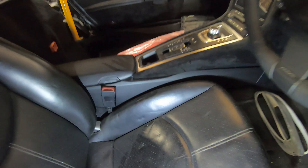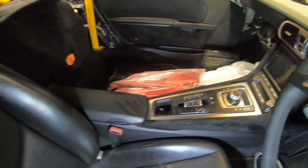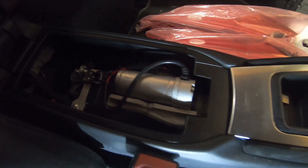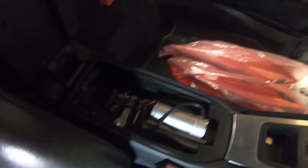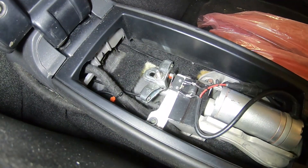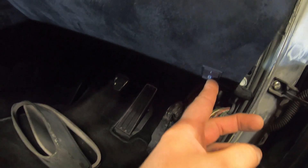I've got a 911 PDK-style surround with the hole enlarged, and mounted my drive and reverse selector switch in there — it all sits lovely. To have this center console you have to get rid of the handbrake lever. So in the glove box I have an actuator mounted in the original handbrake bracket that moves in and out, pulling the cables. There's a micro switch to adjust how much it pulls, run off a couple of relays with fused boxes, giving me a handbrake on/off switch.